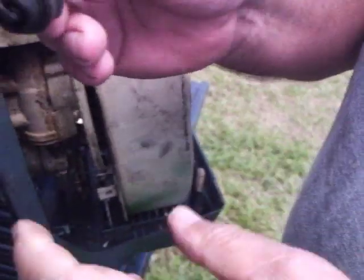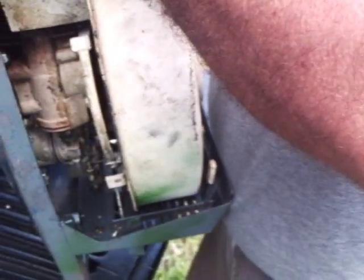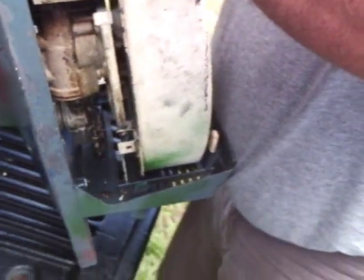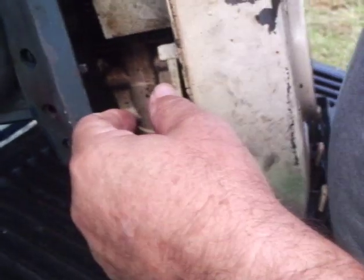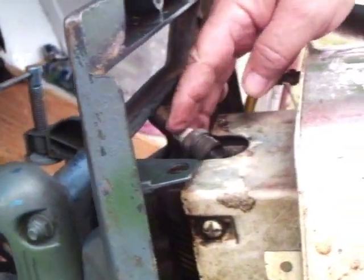They may not need anything anyway — hopefully this motor is real good. Points almost never are the problem anyway; unless they burn out, the condensers are the problem. We'll check for spark — will it fire? It will fire. There's no fuel and this isn't going in the hole, it's just going right there.